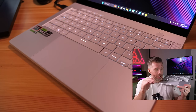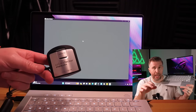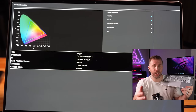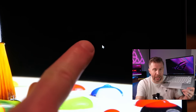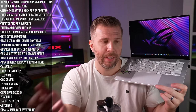The touchpad is glass, large, with a 16:10 aspect ratio, excellent placement — I love it overall. The display measured at 416 nits brightness, 100% of the DCI-P3 color gamut, and roughly 120,000:1 contrast ratio — phenomenal. However, 416 nits is not as bright as the mini-LED version of the 2023 G14, which goes up to 600 nits at 165Hz; the OLED here is only 120Hz, so for esports or high refresh rate gaming, the 2023 mini-LED version is arguably better for display quality.